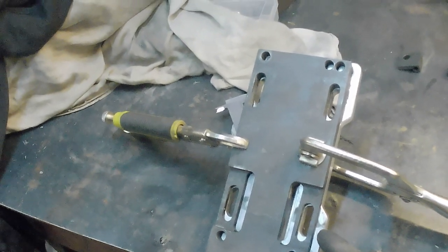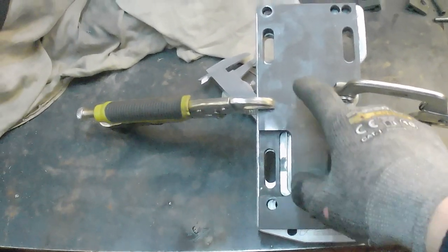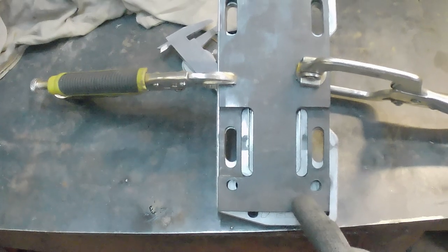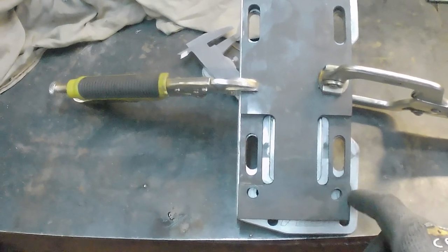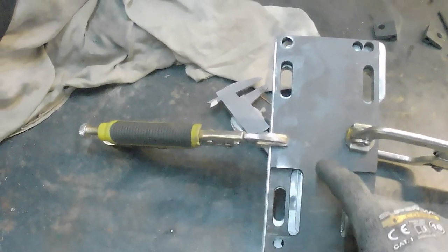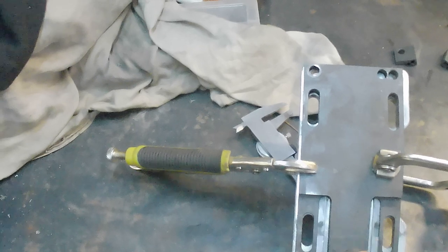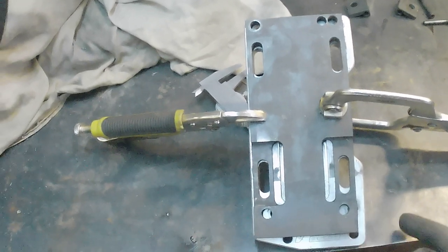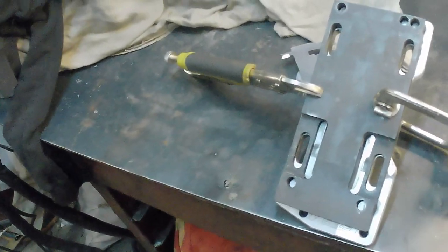So this original aluminium Vulcan plate was offset one quarter inch. I have this plate from my open primary - I'll use it as a template to drill new holes on the aluminium. Then I'll weld up the old holes. You might ask why I don't just use this plate, but I have a plan for my other chopper with the open primary since it's adjustable. I looked in the catalog - a new plate is about 40 euros delivered. Why not save that and fix the old one.